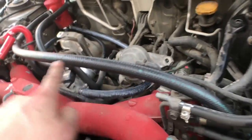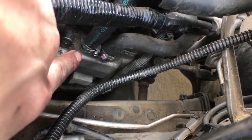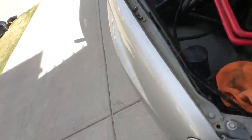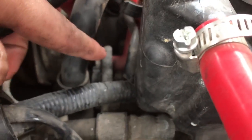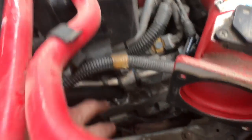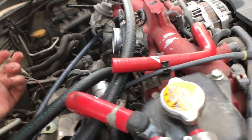Making good progress: one vent hose runs along the top, in front of the intercooler and intake, then down into the separator port. On the other side I had to remove the intake; the hose runs from the bottom down to the front. I tried routing it through the OEM hose path but it would kink at the bottom, so I avoided that.